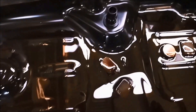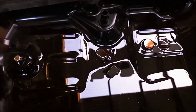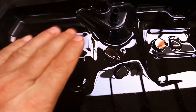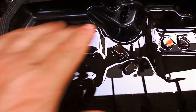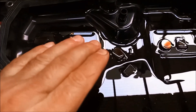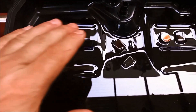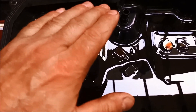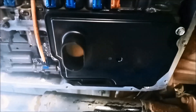If you've got too much oil in there, once the oil gets up too high and hits the spinning parts, it can aerate the oil. And the same can happen if you haven't got enough oil in there. Because he tows, we're going to adjust it at the lower level because the oil expands with heat. He does a fair bit of towing, so we're going to try and keep the oil level at the lower end, which basically means we're going to have a higher temperature when we check it overflowing over that tube.